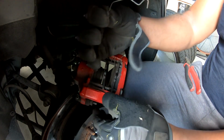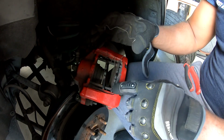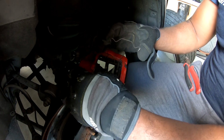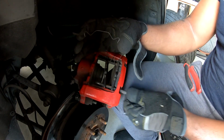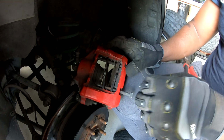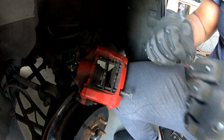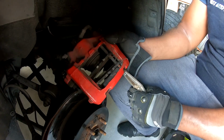This right here goes down and locks both of your back pins, and it goes in these holes to keep these pins in here. See, now these pins can move freely. If you lose this, you might lose your back brakes while you're on the road, FYI. So always make sure this goes back in. Put it back in last.